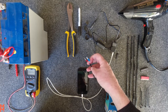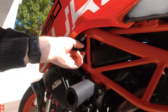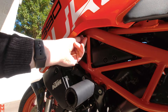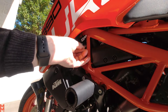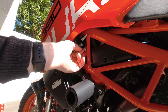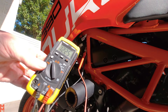The black connector is for the negative or ground, and the red is the positive line. Now I've got a close-up — just on the left-hand side of the bike there are two sets of terminals. I've poked them out from under the fuel tank. KTM bikes come with two sets of powered auxiliary outputs, and I've marked these up.